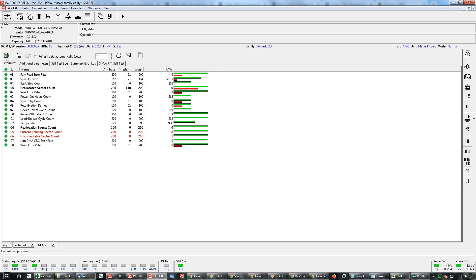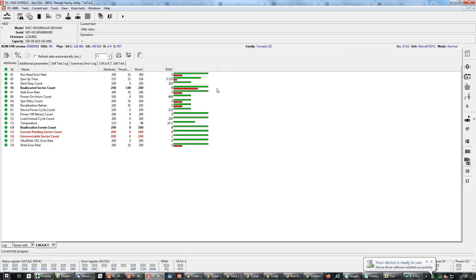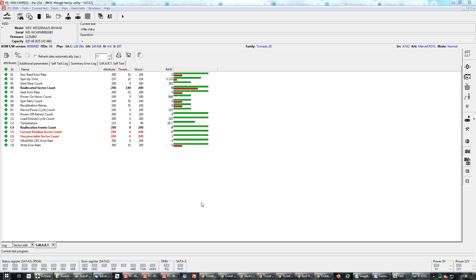Smart status — doesn't look too bad actually. So I went ahead and plugged this same drive into a regular enclosure, a three-and-a-half-inch adapter. Let's see if it shows up in Windows. I always like to do this just in case the drive has any issues. But the drive isn't in the best shape — I'm going to actually run one more test from PC3000, quickly test the heads to see what's going on with it and make sure there's nothing else wrong.